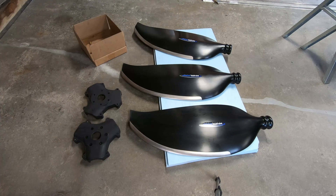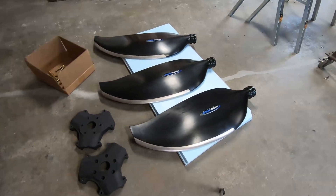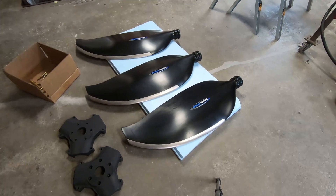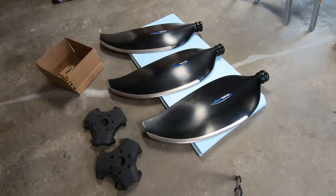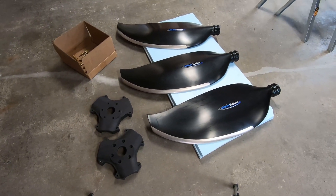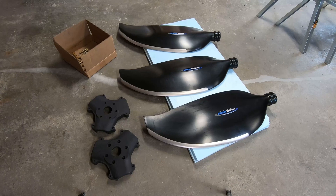So this is a Whirlwind. It's a specific prop for airboats. This is the super wide — it's an 80 inch diameter three-bladed prop. Apparently it needs about 500 to 550 horsepower to spin it, so it takes quite a bit of power. It's a pretty huge prop really, so hopefully that works out.